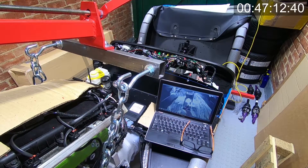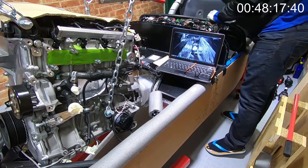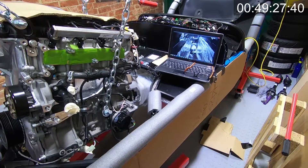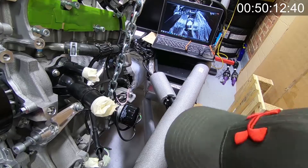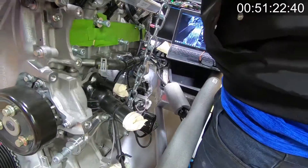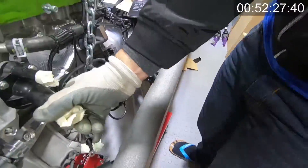I was a bit slow on moving the camera, but in this move I pushed the engine into the tunnel by hand and lowered it to clear the top chassis rails. You can see how close the sump is to the chassis — that's why I say use rubber hose on these rails and not pipe lagging. Even the thinnest pipe lagging is about 10mm thick compared to the hose which is only 4mm thick. You might think 6mm isn't much, but even with the rubber hose in place I had my doubts it was going to clear. I then became stumped again as to why I couldn't get the gearbox further into the tunnel — it turned out the same piece of cardboard used to protect the footwells was fouling on the bell housing at the front of the tunnel. A thin piece of ABS sheet would have been better to protect the footwells.